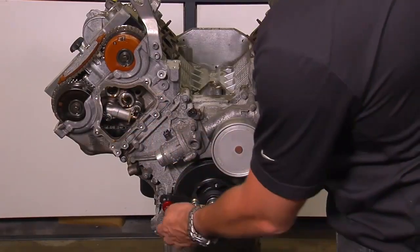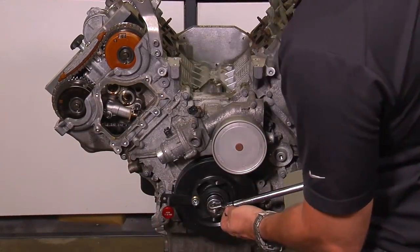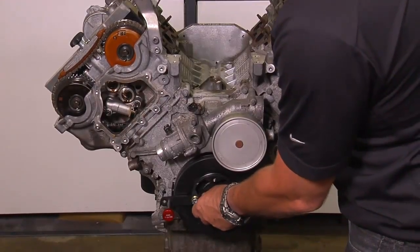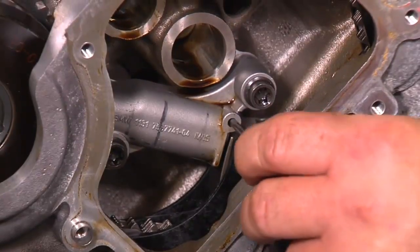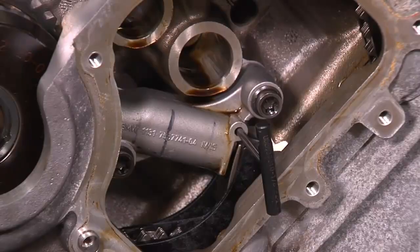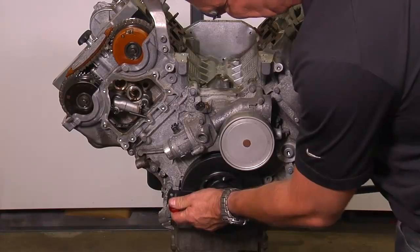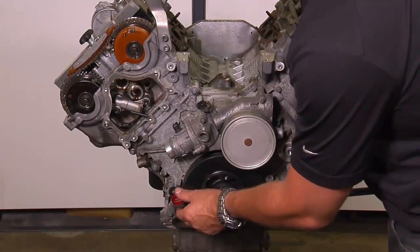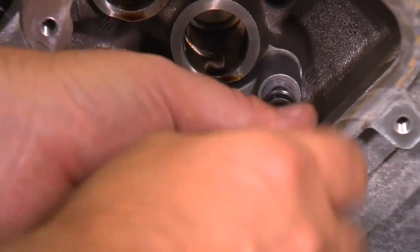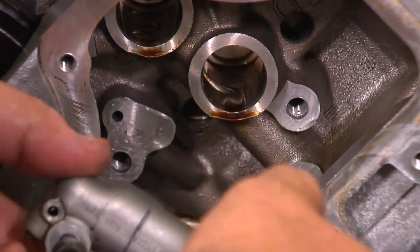Here's a really quick trick: pull out the pin for the crankshaft and gently rotate the engine in a backwards direction. This compresses the timing chain adjuster and allows you to insert the pin. Now gently rotate in a forward direction back until you can reinsert the pin. This takes all the tension off the timing chain adjuster and you can now freely remove the hydraulic chain tensioner.